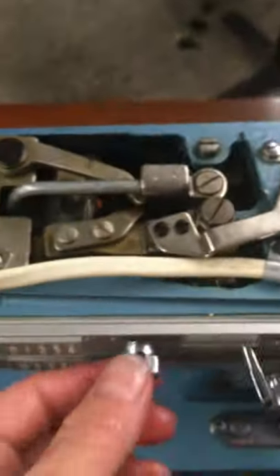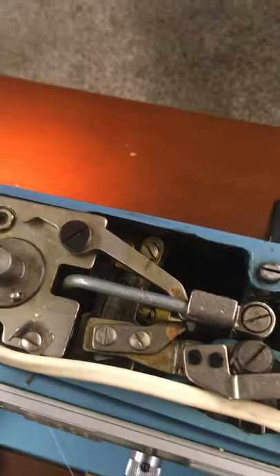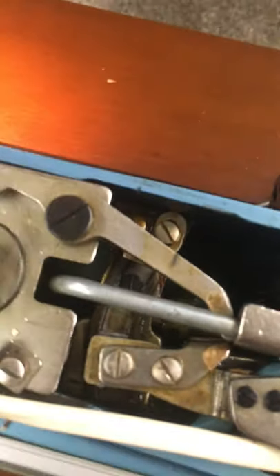So back to this one. Machines with metal gears — where there's nothing plastic in there — these machines don't break. People bring them into thrift stores all the time; they throw them out because the machine got jammed from sitting for 40 years with old oil hardened in it. It's not a broken machine. Nine times out of ten — I'd say 9.8 times out of ten — there's nothing wrong with it, it's just jammed shut. Lubricate it properly, then look for any movement that's stuck. Your timing can be an issue, but that's rare.